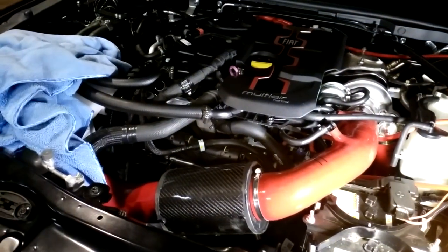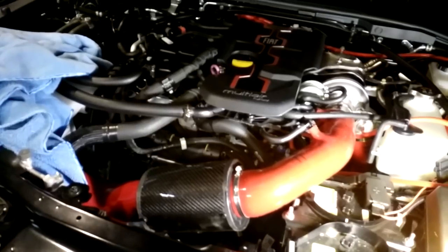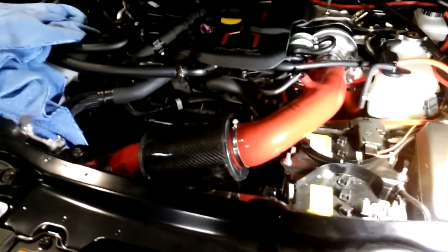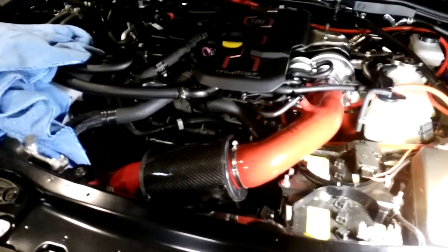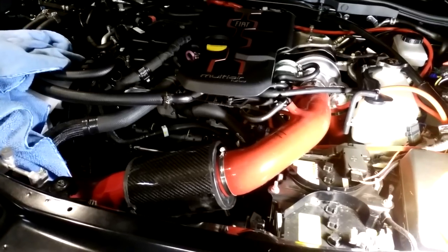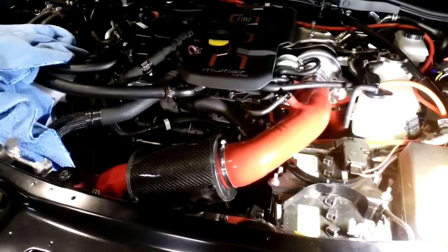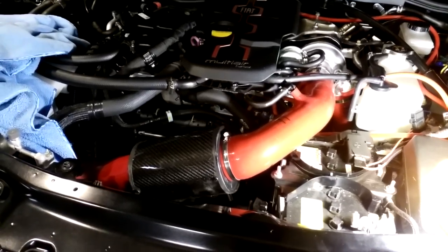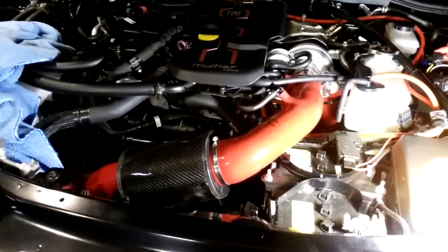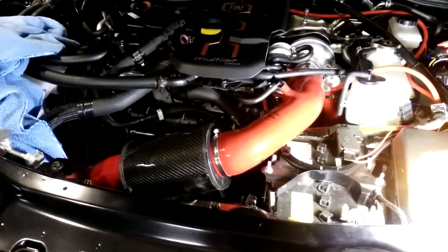It also has an interesting ability in that it can change boost levels of the engine when the water injection kicks on. It could be something like war emergency power in a World War II airplane, where water spray kicks on and then manifold pressure — which we call boost here — would go up. Water kicks on as sensed by a pressure switch in the line, then the computer not only regulates the water flow but raises boost, say three or four pounds, to really take advantage of that spray. It's a really slick computer.